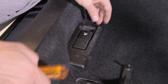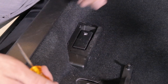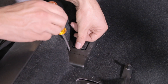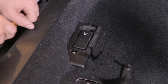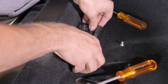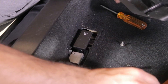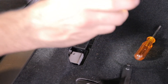The fuel door lever is right here and it's also holding the carpet in place, so we're going to have to remove it. This little trap door right here has a little notch for the clip, so you just grab yourself a small flat head and stick it in there and that should come right out. And now you've got yourself a Phillips screw. Pull that out. I'm going to go ahead and put the screw back in there so that I don't lose it.